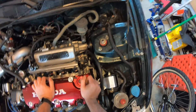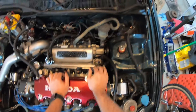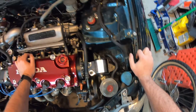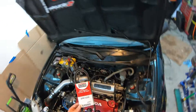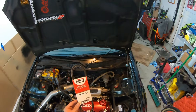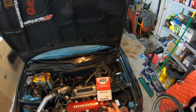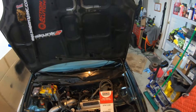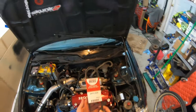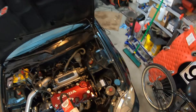One other thing to mention regarding the supercharger belt and how tight it is: you want to be careful when tightening the adjuster down here. You don't want to go too tight — leave a little bit of play in that belt. If you go too tight it'll snap the belt under load, and you don't want to be stuck on the side of the road because the car runs like crap without it. Speaking of the belt itself, the replacement belt is a Bando 3PK1220. You can get these directly from Moss Motors, who took over from Jackson Racing, but they want like $15 to $17 a belt plus shipping. I found them on Amazon by searching the part number — last time I bought one it was about $7 with Prime shipping and you get it in two days. These do wear out; I've gone through three of them. I always keep a spare in the glove box along with a 17mm wrench just in case I throw a belt.